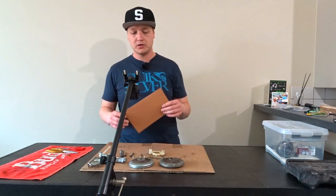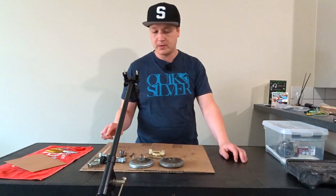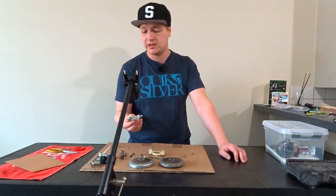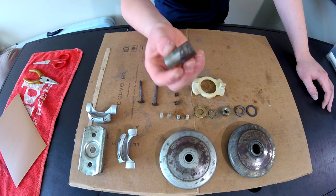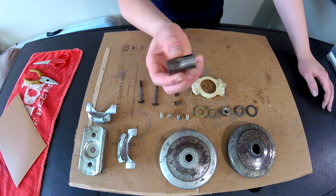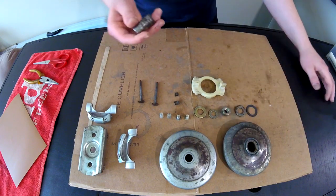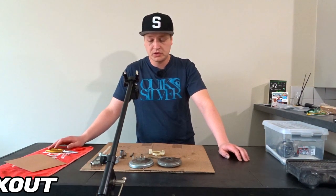To clean up the dishes I'm going to use 500 grit sandpaper. I'll use my Dremel with the metal brush to clean up these parts, and I'll attach some Scotch-Brite to a Dremel tool to clean up the aluminum parts. I'm probably gonna sand this one and then polish it until I get a nice shine, and probably turn it around so the shaft that moves on it goes onto the clean part — or if I can get it good enough, maybe use it as-is.